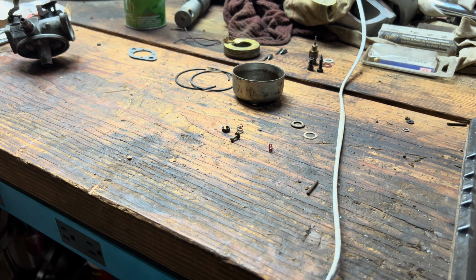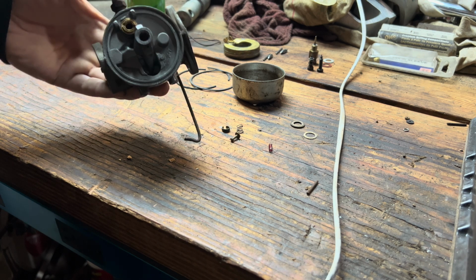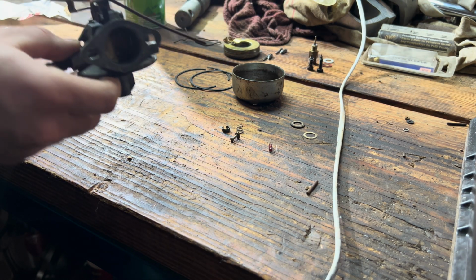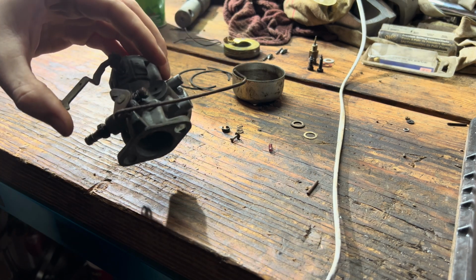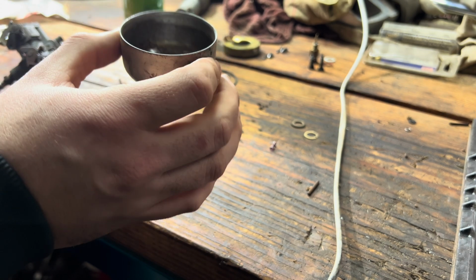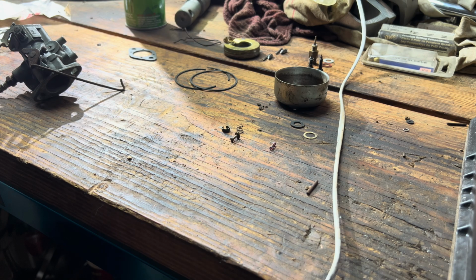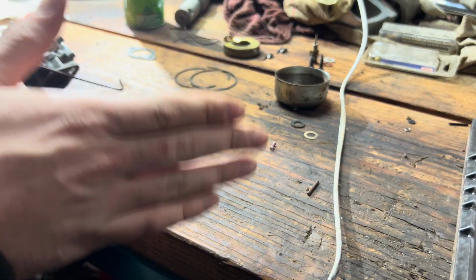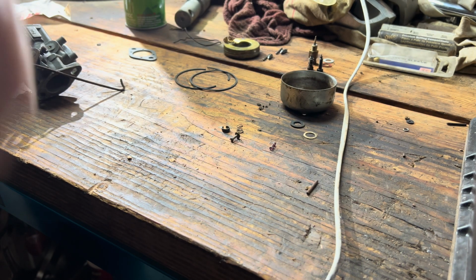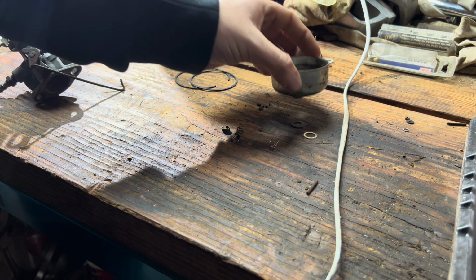All right, heater's off. Probably hear me a lot better. It doesn't look that much better in the light, but it's a lot more clean now. So hopefully this will look significantly better. I kind of did a quick over of the bowl. It's not in very good shape. There's some rust that's pretty stuck in there, which usually, 90% of the time, if you're going to clean the bowl, clean it good. But in this case, that rust is pretty embedded. The likeliness of it breaking off and going anywhere is pretty slim to none, because it looks a lot better than when I first started with it.